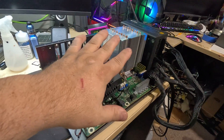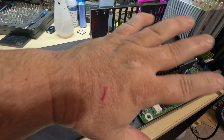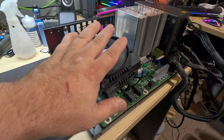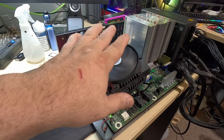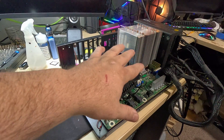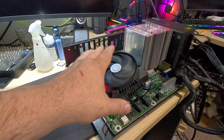After hours of testing to figure out what's going on, I finally figured it out. My old 7551P Naples CPU works perfectly fine in this system, but the 7742 CPU I bought boots and gets stuck on POST code 22. According to my Google searches, that means it's a vendor-locked CPU — most likely locked to Dell or Lenovo — and it was never disclosed in the eBay listing. I triple-checked: it was listed as a regular, tested, perfectly good CPU. So now I need to argue with the seller, send it back, get my money back, and get an unlocked 7742.